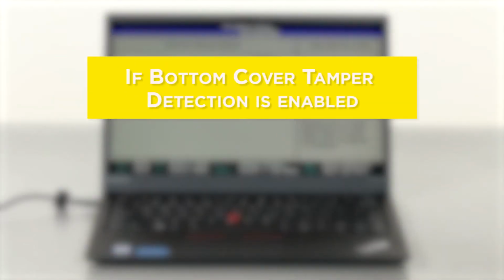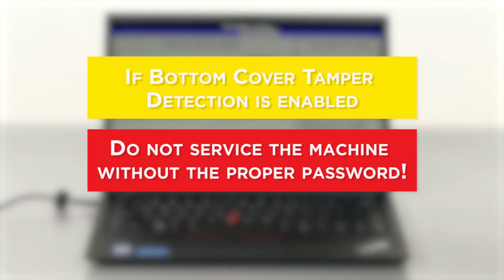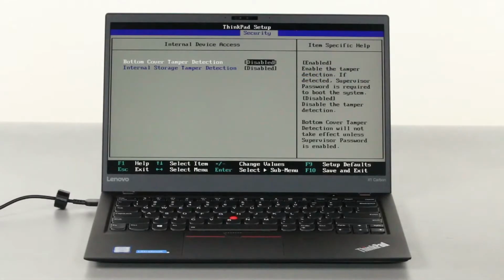If bottom cover tamper detection is enabled, removing the bottom cover will trigger a password prompt the next time the machine is powered on. Do not service the machine unless the customer can provide this password. If the customer does provide the tamper detection password or if the setting is off, proceed working on the affected system by disabling the internal battery.